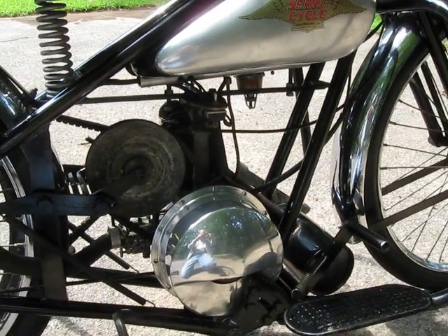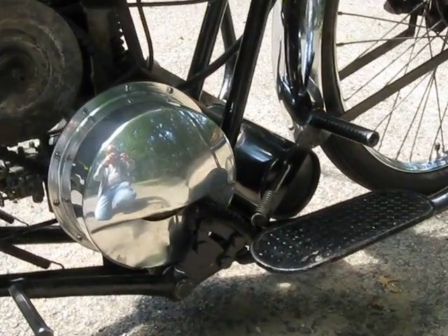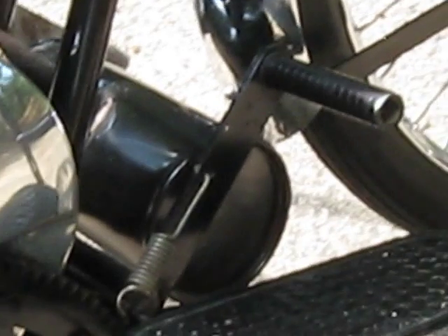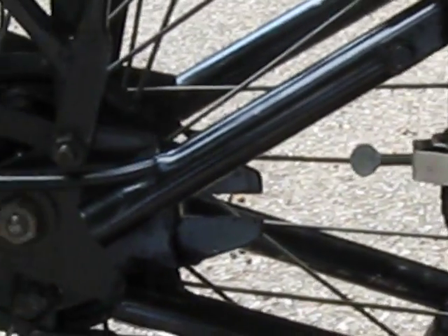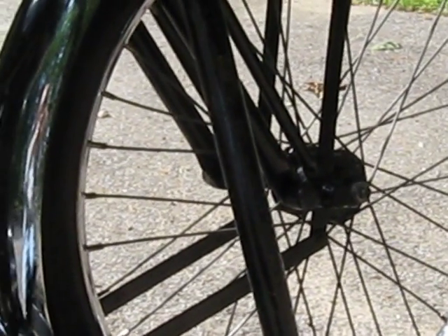The last of the controls: there is a foot pedal brake right here — rear brake only. There's the brake lever, rear brake only. There's the rear brake drum. The Simplex has no brake on the front wheel, at least not in this year.